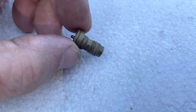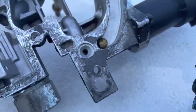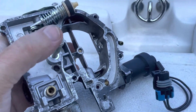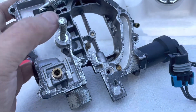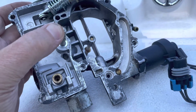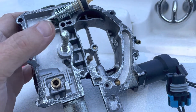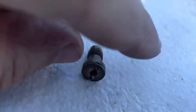This power valve is operated by vacuum. This is the top of the carburetor — this little plunger here is spring loaded. When the engine is running, vacuum through that hole right there sucks this plunger up into the top of the carburetor. But when you're underway and under heavy load, your vacuum signal goes away, so this steel plunger drops down under spring pressure and presses on top of that power valve right there.